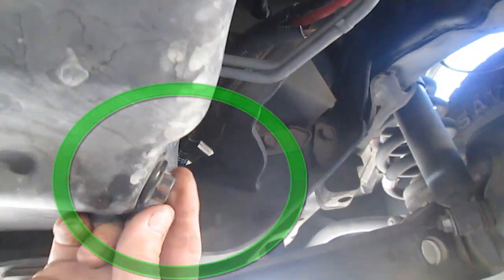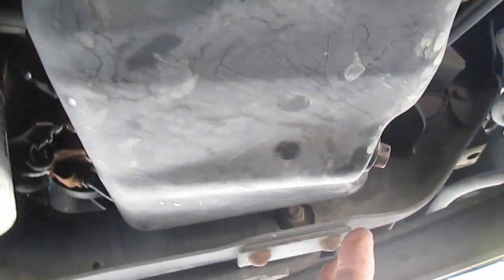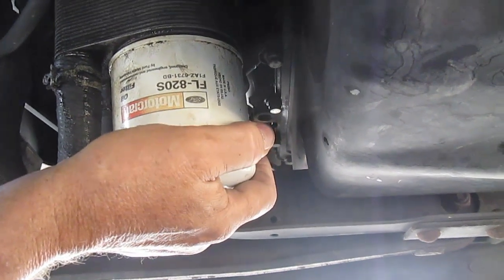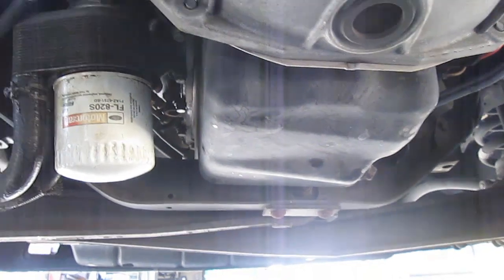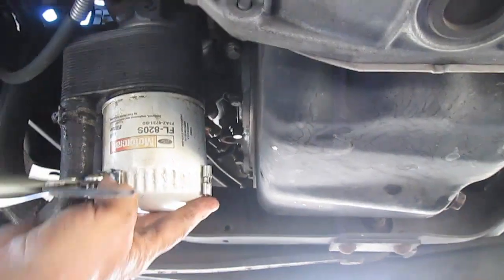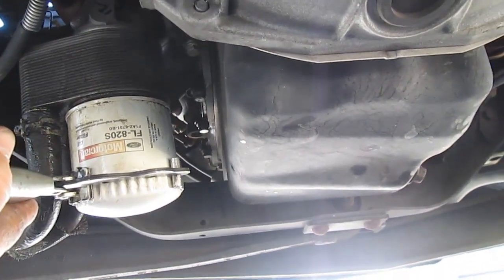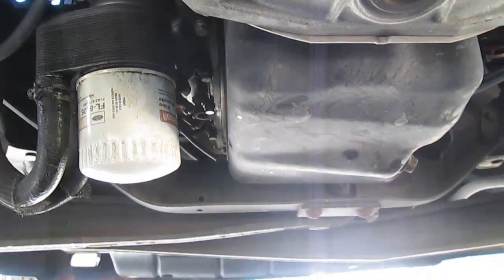So what we're looking for is this bolt here, which when you take it out all the oil will come out. Let's just do the filter first, which is right here. Sometimes they come off easy, like this one won't — somebody tightened it a little tight, not mentioning any names. So in that case you use a filter wrench. It's a pretty simple device and it just clamps right around there. We want to go counterclockwise to take it off. You put it on, and then this just clips over the edge, and then you can give it a little twist — oh, here it comes, good — and it'll come off. Once you get it going it should come, there you go.